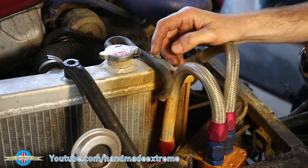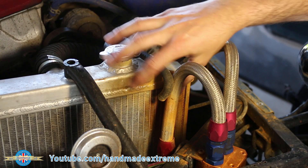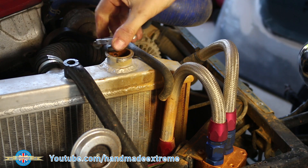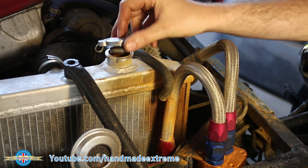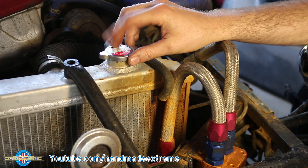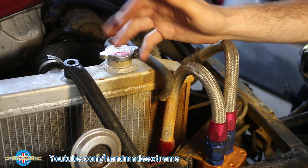This doesn't look so good — I've got a load of brown spray that's come out of the radiator overflow pipe. I think this has happened because I've mixed two antifreezes that aren't compatible, and that's sludged up the radiator, making it less efficient, which has ultimately caused the car to overheat. When a car overheats you stand a much higher chance of blowing the cylinder head gasket, so let's just check that's okay.